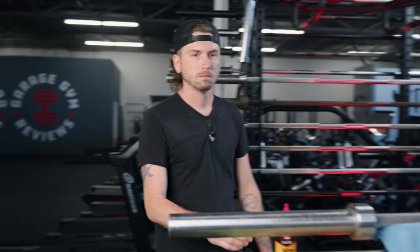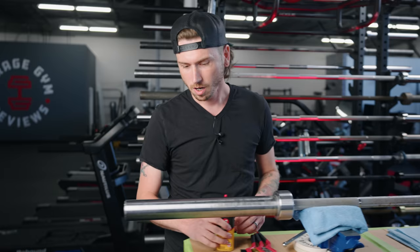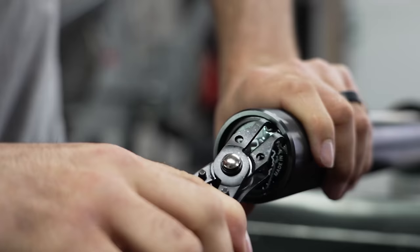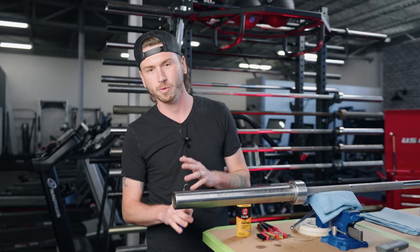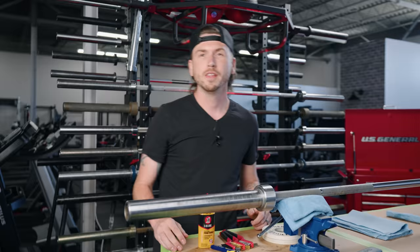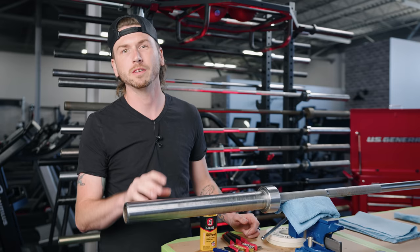Alright, let's get into the actual cleaning of the bar, starting on the sleeves. Sam, come on. What's up guys? I like to get my bar nice and clean — I like to use three-in-one penetrating oil, works every time. Whenever cleaning your barbell, there are a couple of things to be aware of. I also do not recommend these pliers — they don't work great; they exploded last time we used them, but they were the only pair Lowe's had in stock when we decided to build out inventory for this video. Most bars are the same when you're taking them apart to clean. You're going to have a snap ring, then your end cap, then another snap ring, and in most cases the sleeve just slides right off. Some companies do have proprietary designs. This one is an American Barbell — it should be pretty straightforward.